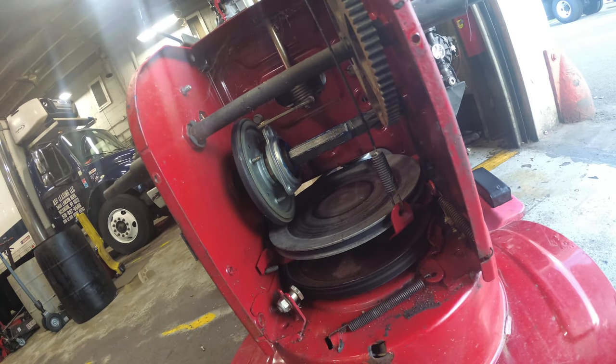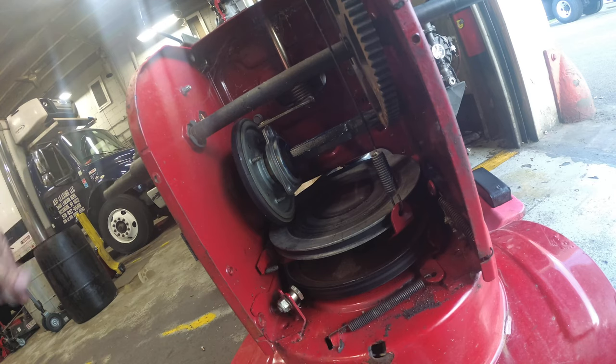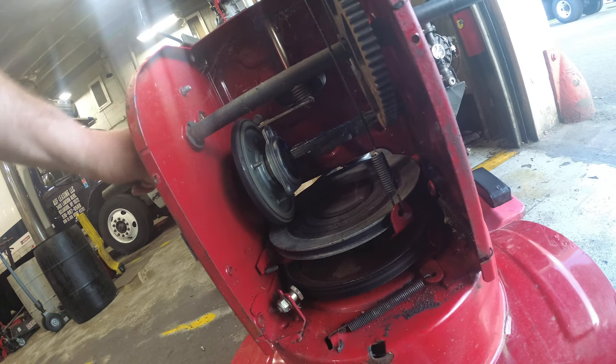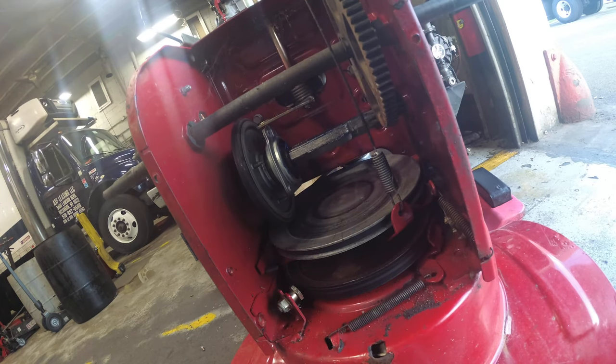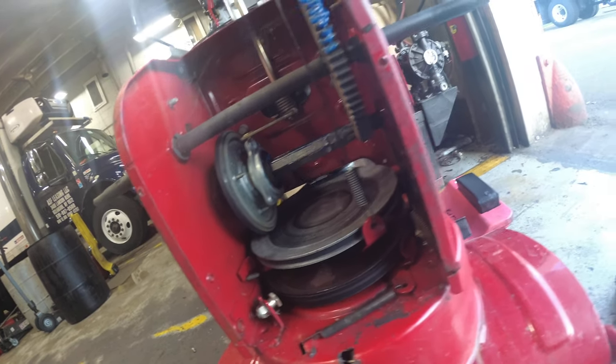That's greased. Now as far as the wheels go, we'll pull off these plastic spacers because that's what they are. We're going to expose the shaft. See? Spacers out. And what I like to do with this part here is I just like to put a little bit there, because then as we spin the shaft, it'll lubricate itself.